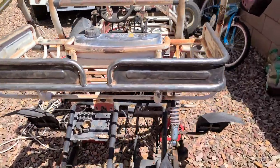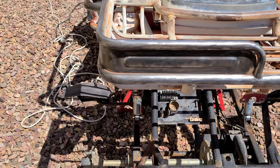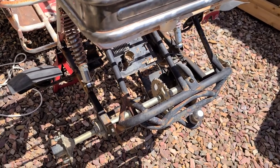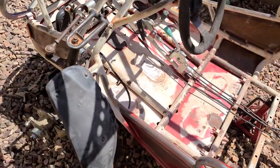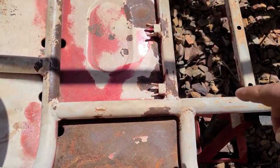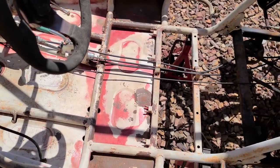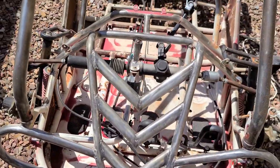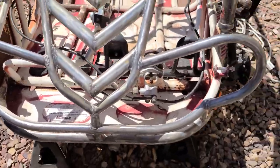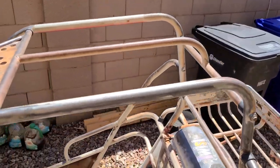I was able to get quite a bit sanded down yesterday. I have to wait a little bit before I can start grinding again — my wife and children are all working at home, so running a grinder may be an issue. But as you can see, I've started bringing it back down to metal. On the inside I'm going to hit any of the spots that are rusty, get everything cleaned up as best I can. I got this sanded down in the front, so I got a little bit more work to do on the cage to get it prepped. My job today is to get this thing in primer.